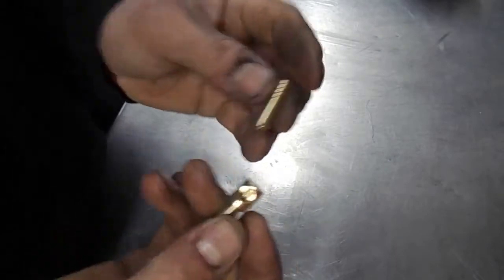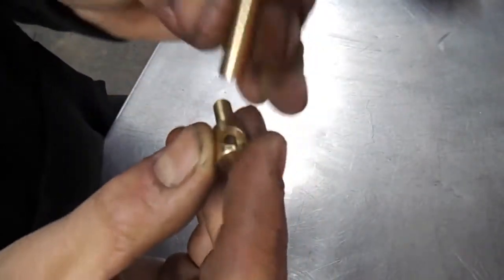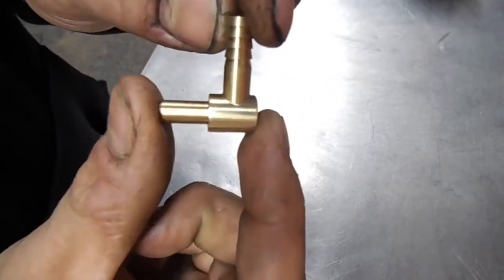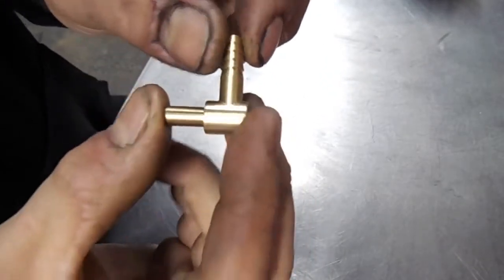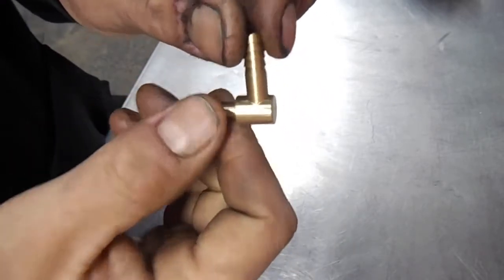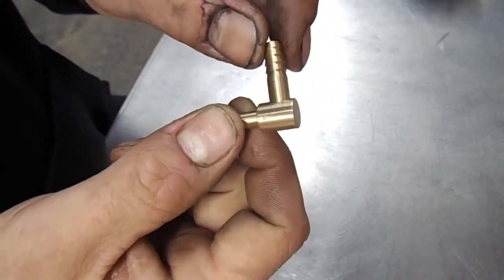Here's what I've just made - basically you've got this part which presses into the carb, and then this part here which just needs to be soldered on. So I'm going to do that next. What I'm going to do is tin this and then drop that into here, heat it and maybe add a little bit more solder around the joint, and we'll see how that comes out.